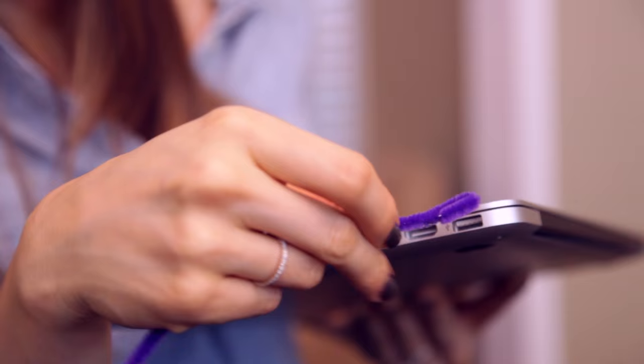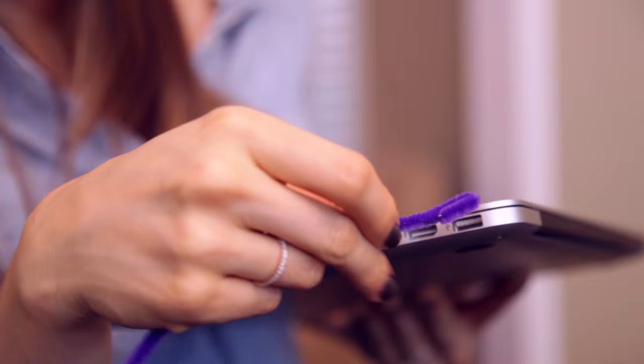Finally, you can use the compressed air or the pipe cleaner to blow out or remove debris from the ports, the vents, and all the other little hidden areas on your computer. And that's it — congratulations, you just cleaned your laptop! Cleaning your laptop is like a one on the difficulty scale of life, so show it some love by giving it a quick clean every couple of weeks.